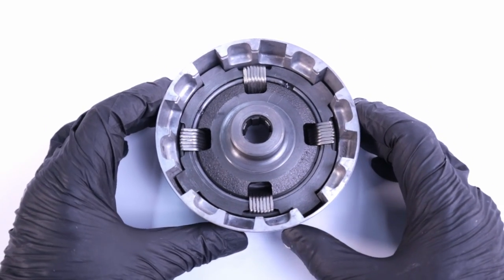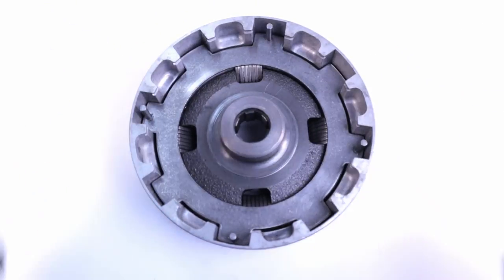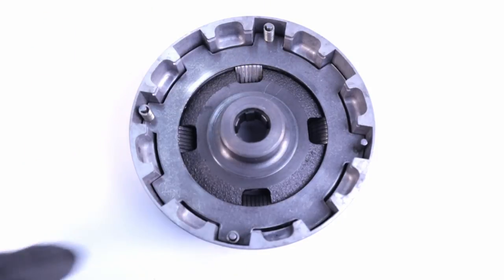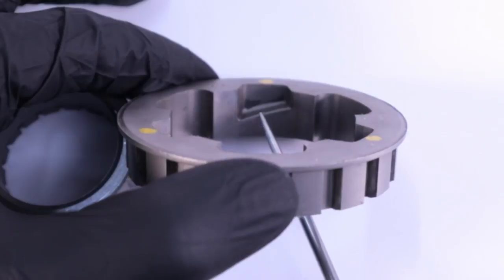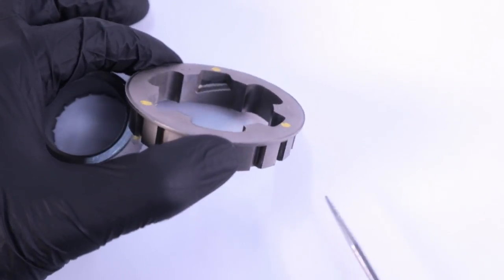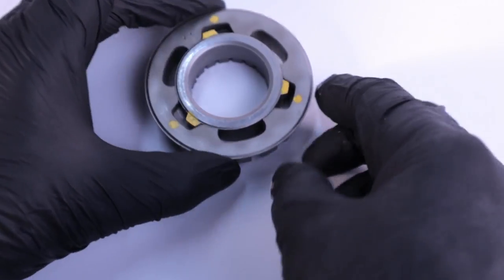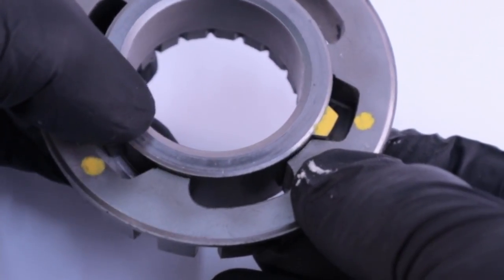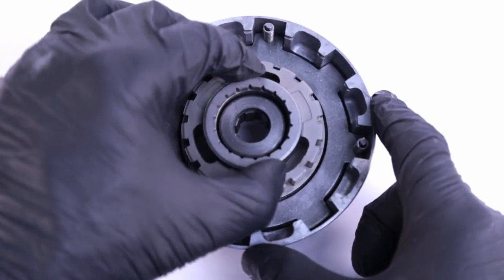Flip the clutch over and let's install the clutch system. Line up clutch plate A with the slots on the inside perimeter of the clutch outer cover and install. Install the four free springs on the spring posts. The clutch center has angled bosses that interface with little ramps inside the drive gear outer. Centrifugal force engages this ramp and acts on these two components to create a lifting effect, which closes the gaps between the discs and causes them to engage. With these two parts paired, install them around the center of the drive plate.